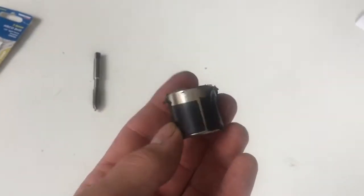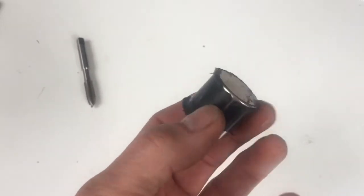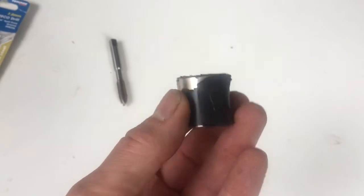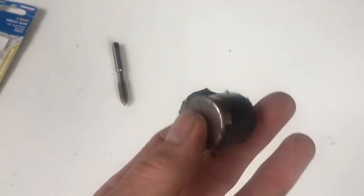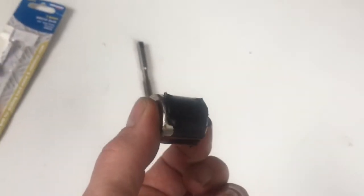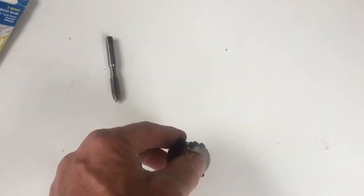Last but not least, make sure you've got a very strong magnet to hand so you don't end up dropping metal filings inside the cylinder head. This is a neodymium N50 magnet, means it's got a 50 kilogram pull. They're not particularly cheap, you can get them on eBay, but it's well worthwhile for magnetising your tools to avoid dropping little bits of metal.